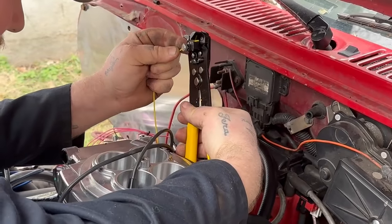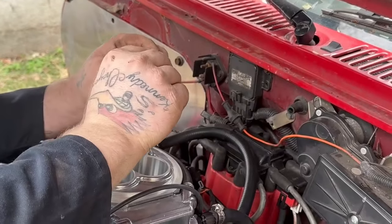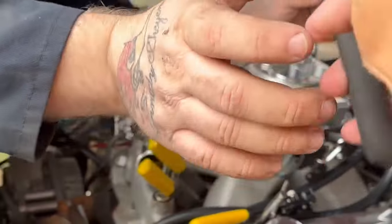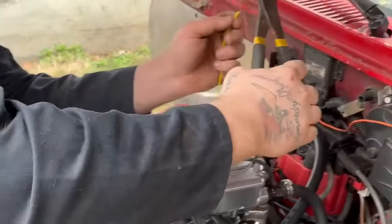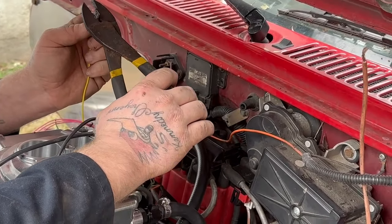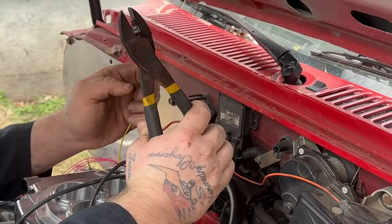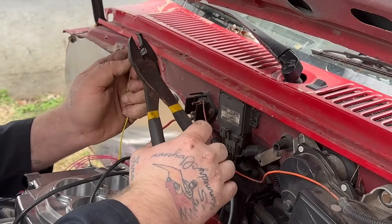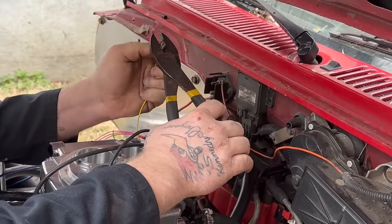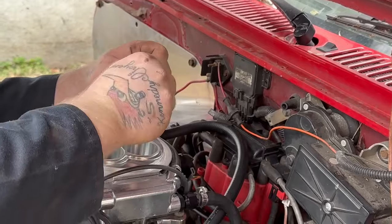You've got too much friction left for these little wires. Alright, I started it. I got it set up for big wires. It's got a little bit too much pressure on it. But those wire strippers, if you set them up for little wires, you literally just squeeze the handle and it does the whole procedure for you. It cuts the casing and then peels it off, just by squeezing the handle. Pretty cool. Now don't fight with me.